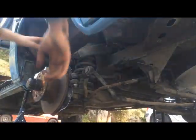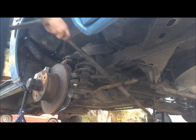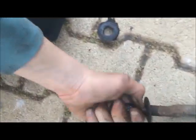You can see the sway bar. Let's pull it up. And pull it. There you go. Here is your sway bar. Remove the bushes and sort out what you need and what you don't need. You don't want this bushing. It's crap. It's going to be tossed. And this sleeve here is rotten. I thought because my van is rust free that it wouldn't be. But I think I get it with the polyurethane kit. I will see. If not, I will order them. Remove your rotten sleeve.